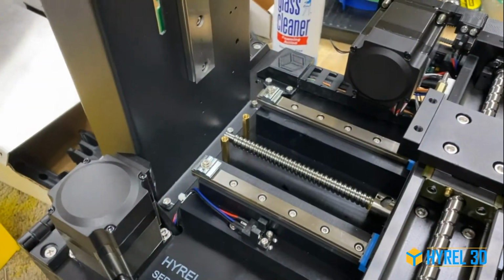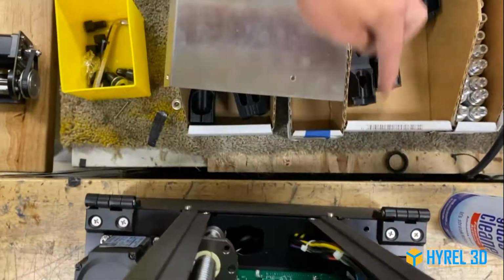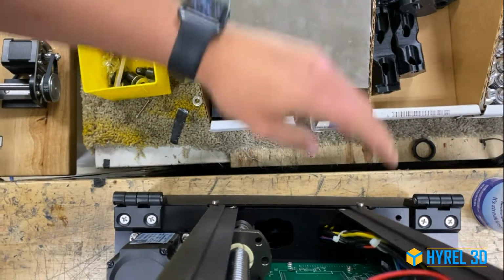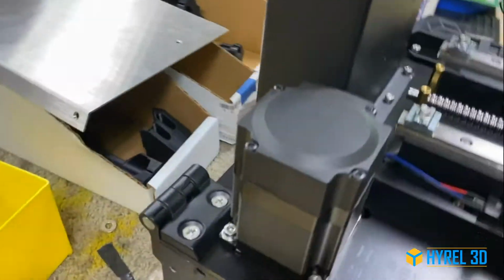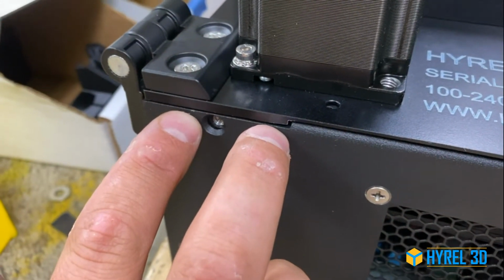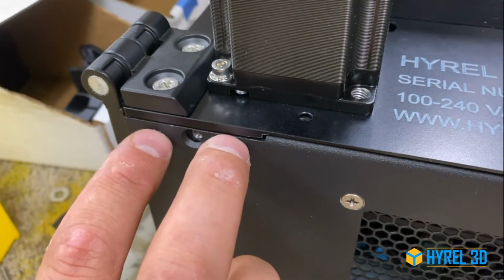Of course, if you've been using filament or some other materials, you probably installed the spool rod over here. I definitely recommend removing this spool rod holder from here and putting it on the side somewhere. It also depends on the version. The oldest version has 2 M5 screws over here, and you're going to need a Phillips driver. I would recommend still using number 2.